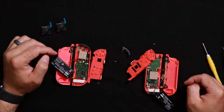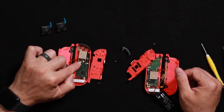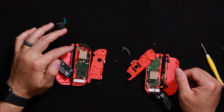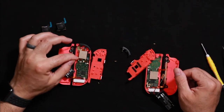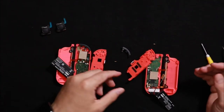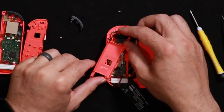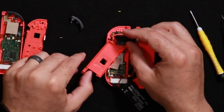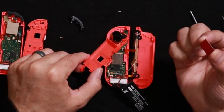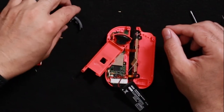If you're replacing the joystick on the left Joy-Con, you would have to pull out the ribbon that's connected right here to get to that screw safely without damaging it — just take note of that. Aside from that, we're good to go on everything else, so we're just going to put it back the way we took it apart. This one was a little bit funky with that ribbon, so you just have to be careful not to pull it out. Be careful not to let it slip — you can use some rubber cement or a thin piece of double-sided tape to get that to stick.